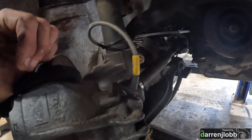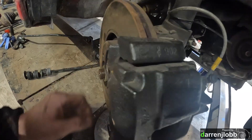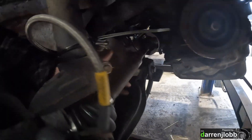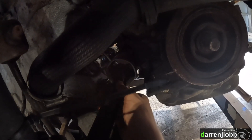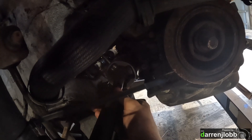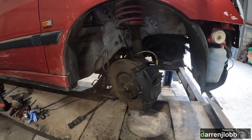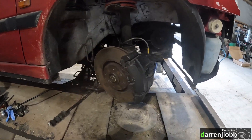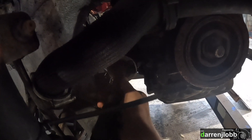I've just temporarily put the full joint back in. We've got that driveshaft just slipped into position now. The hub nut is on and tightened down to make sure we've got the shaft pulled right out. You can see that gives us a little bit of adjustment of where we position the length of the shaft. So first I'm going to put the wheels back on, drop the car back down, and just roll it forward and back so it settles into its normal ride height position. Then we can make sure we set this where we want it.